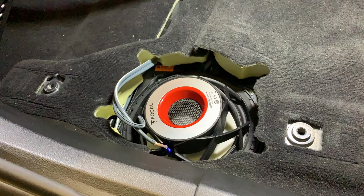Before I went ahead and started the front sub enclosure, I spent several hours testing to see how the mid-bass performance is affected if I flip the four-inch driver upside down, so we technically give more airspace underneath the driver in that outlet the BMW platforms have, and what change that could bring.